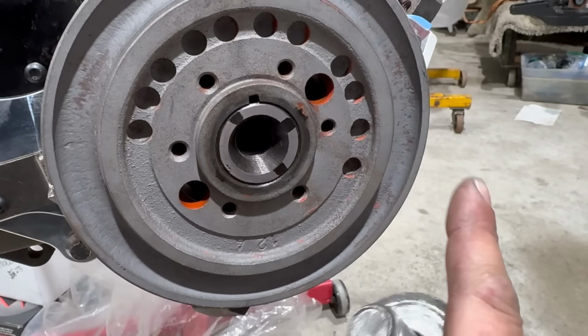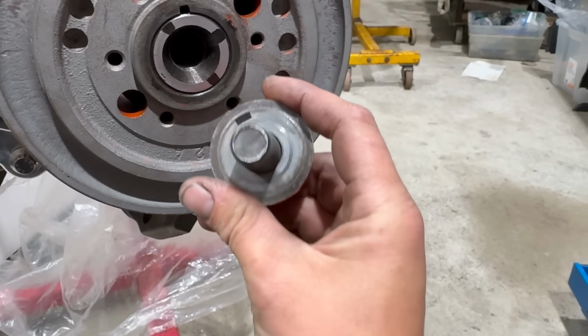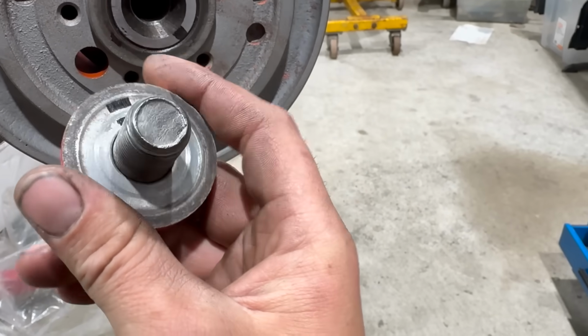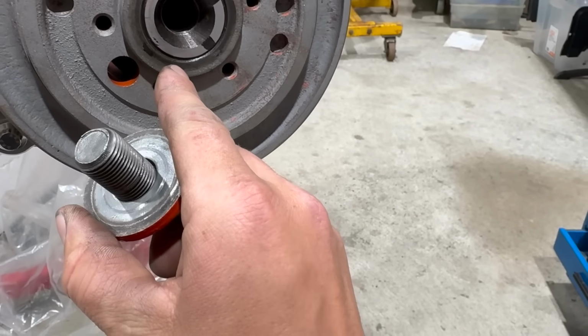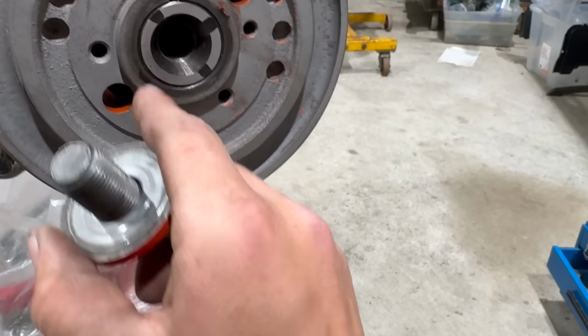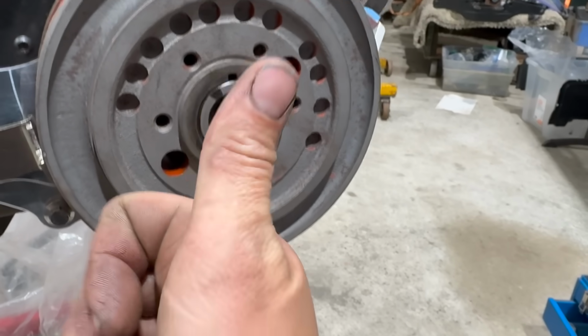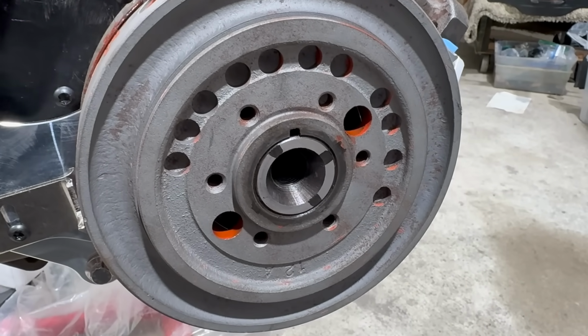Okay, we're almost good. I marked it in 4 places on the crank snout and on the balancer. I also drew our same line across the washer. Note, it did slightly contact in the middle, and note 1 mark is gone from the crank snout. That's because my file job isn't perfectly level. I'll take another stab at this, and I think we'll be golden. But that'll be, I want to say, a week from now, Jamie problem?